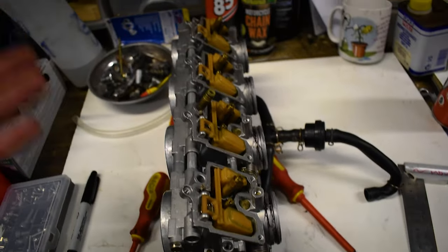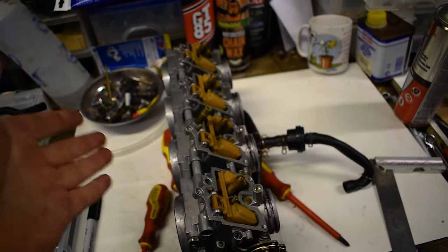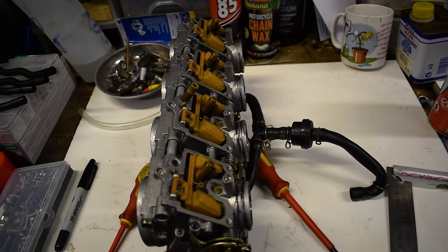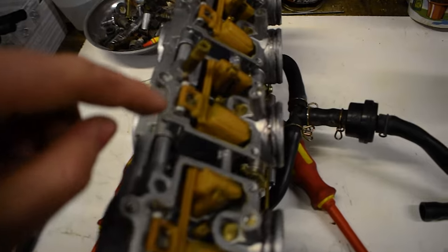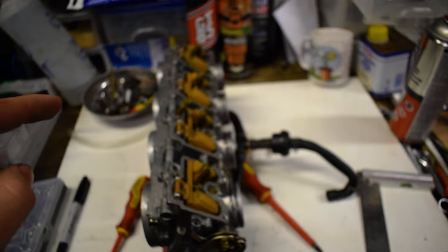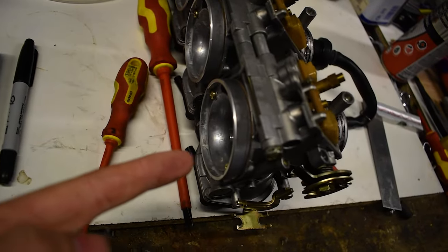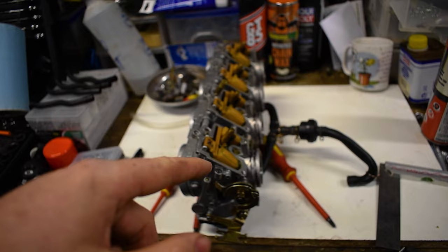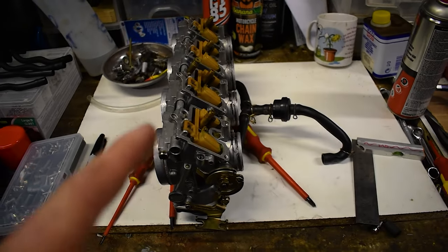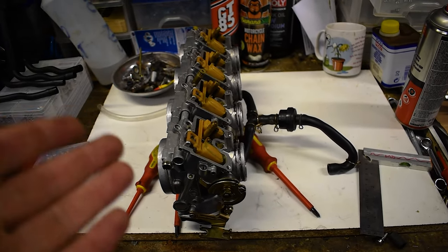You're going to get too much air, not enough fuel, and the bike just won't run and you can melt your pistons - you don't want that. You'll see I actually have messed up all of these ones, so it's a good example. The first time I left it sitting the other way around, which also looks 45 degrees. So it's really important to keep this facing up, which the Haynes manual did not explain well. Then I found the service manual, which did explain it.